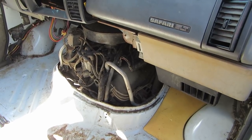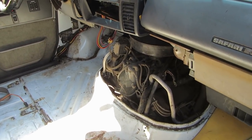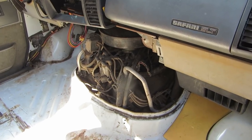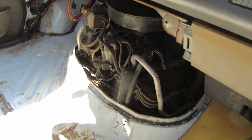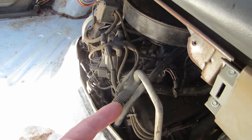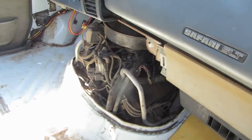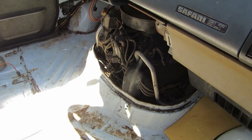First thing you want to do is disconnect your fuel pump. I'm going to get underneath the van and find the plug. I disconnected it right at the gas tank. Some people ask why you disconnect the fuel pump — it's so you're not running fuel to the injection when you have your fuel lines disconnected, so gas isn't spraying everywhere. This works on your Honda, Mitsubishi, Toyota, Land Cruiser — whatever vehicle you have with fuel injection. The general rule is the same: disconnect your fuel pump by finding the fuse, pulling a wire, or whatever method works for your car.